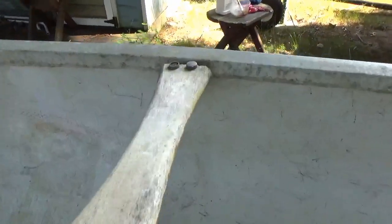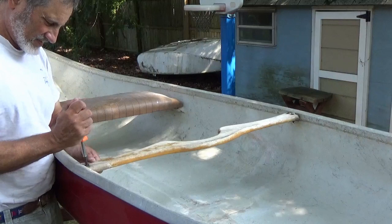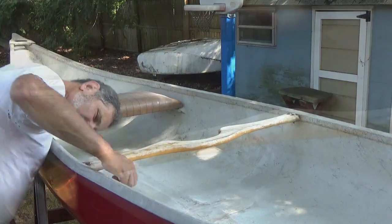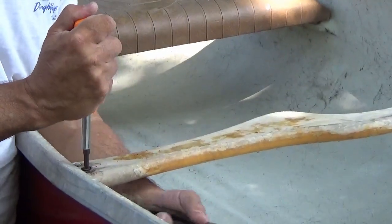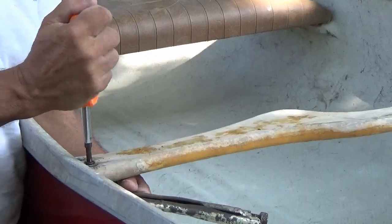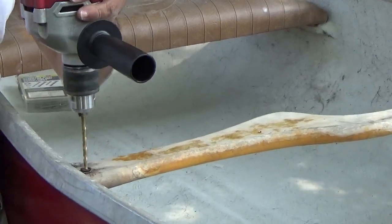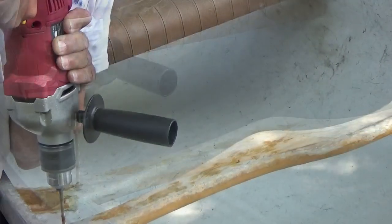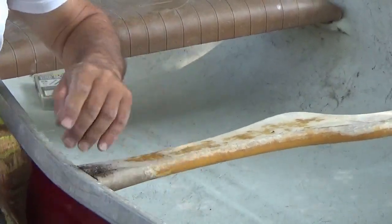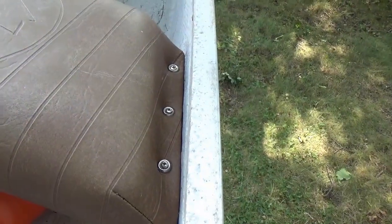This quarter steel port needs refinishing, but all the hardware is plain steel and very rusty so I'm taking it out. I don't mind breaking these bolts because they're getting replaced anyway — they're definitely stubborn. You may just have to resort to drilling them out. All the hardware in the seats is going to get the same treatment — replacing them with stainless steel. The self-tapping screws holding the seats aren't as rusty, but they're coming out anyway. Replacing those plastic caps with stainless finishing washers.